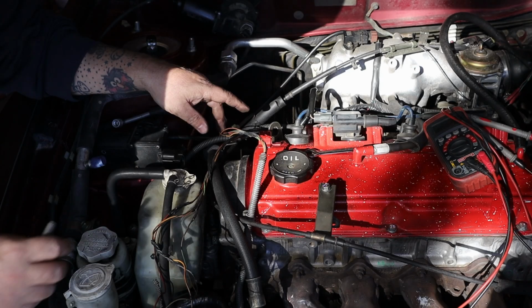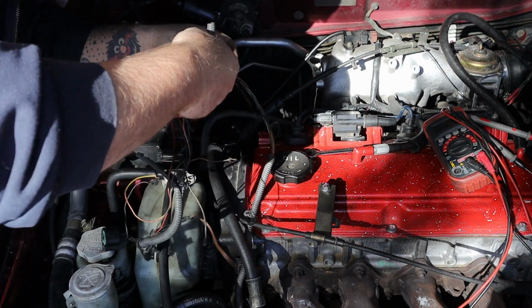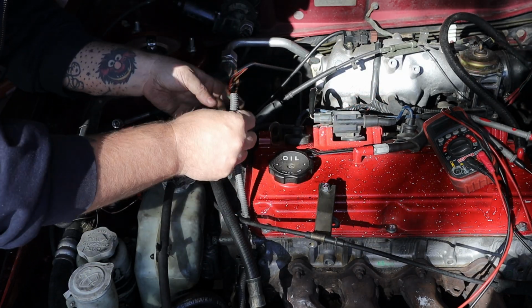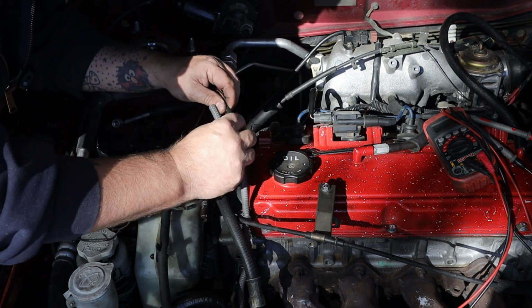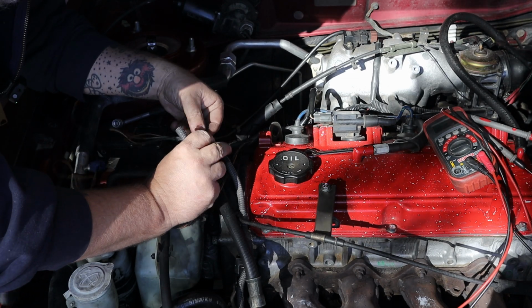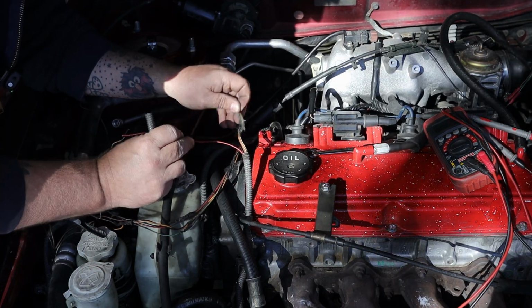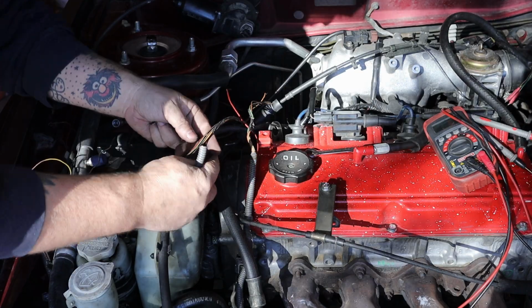For now, what I did was I wanted to get all that run and routed before I pulled this out. So this is your existing wiring harness right here. This is the new one. I wanted to verify all the same wires, which it should be, since it's pulled off the same car. I just want to make sure you had all the same colors, make sure everything matched before I started hacking in anything. I didn't want to remove anything that was sort of working.